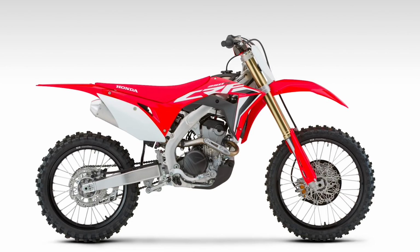The clutch capacity has been increased by 18%, and the clutch spring has a higher rate. It doesn't list why on the capacity. I'm guessing that just means overall thicker plates. Each plate is probably a little bit thicker, which increases the overall clutch pack thickness by 18%, would be my guess is what they're saying there. It doesn't say anything about a diameter change. Also, the clutch springs have a higher rate, so they've got a stiffer clutch spring setup in the bike.